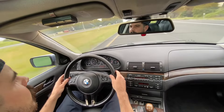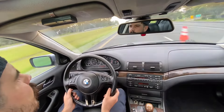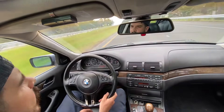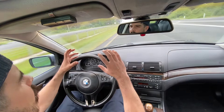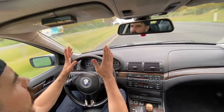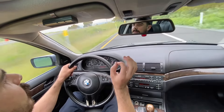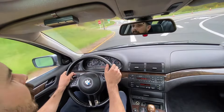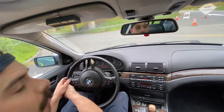It is not even drifting. The alignment is still dialed. The steering wheel is just slightly off, which I could correct — but it is best to take it in just to make sure the toe is in good shape. I used to correct steering wheels all the time. You just have to make equal and opposite adjustments on both outer tie rods — you suck one in and you push one out, thus changing the steering but not changing your toe. The dead spot is definitely gone, so I think this rack and pinion fixed our issue. I need to get it up to 80 and really see if it wants to walk, but I am feeling pretty confident.